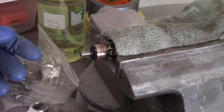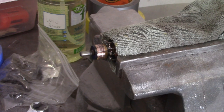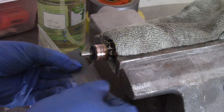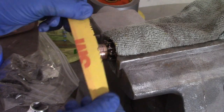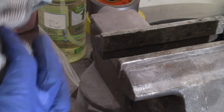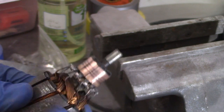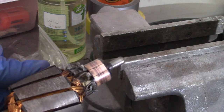If you want motor theory, I'm sure there are YouTube videos on that. I've got a thousand grit sandpaper here - the commutator should be kept relatively clean. I've got a little strip and I'm just going around, not really trying to take a lot of metal off, just getting it cleaned up. The rotor itself is just a magnetic field - there's no electrical connection there. The brushes ride right on the commutator, but on the rotor itself it's all magnetic, so it doesn't matter if that's dirty.